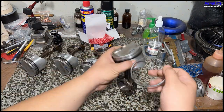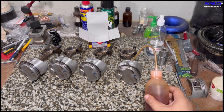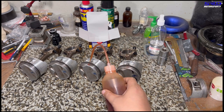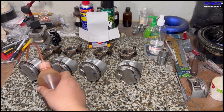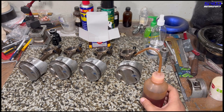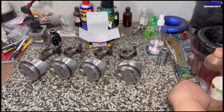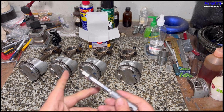We clock the rings before installation, and we use an ATF and mineral spirits mix as a lubricant. It helps break in the piston rings onto the new finished hone of the bore because it's not too slippery but not so dry it's harsh. We use this on almost every engine we build, including VW Beetles. Interestingly, some builders on the VW scene actually install piston rings dry, which also aids break-in.